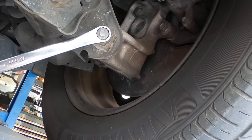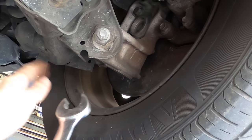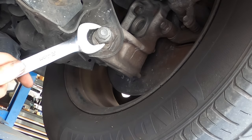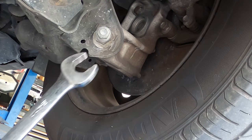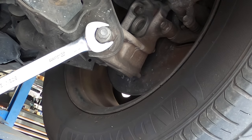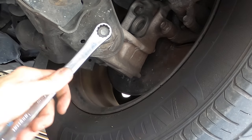I'll crack the locking nut loose — it doesn't need to be removed. I want some positive toe out of this, so I'll move the cam in this direction, forcing the wheel outward. I took a glance at the numbers — I'm at positive 17, so I went too far. Backing it off... negative 1, too far again. These measurements are very finicky and fine. Positive 3... positive 7 — I'll take that. Now I can lock it down, and that completes the adjustment for the right rear.